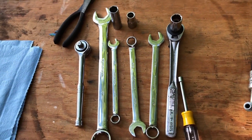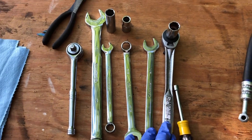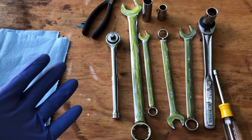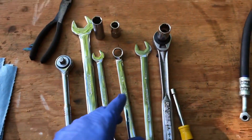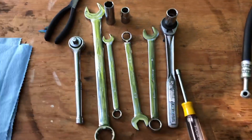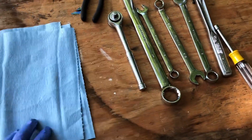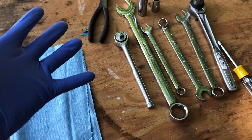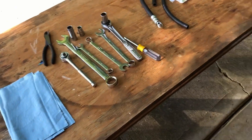In terms of tools, I'm not using any power tools today. An impact wrench would be handy when it comes to removing the pulley, but you can also use a socket. I'm also going to use a breaker bar. Everything is standard except for a 17mm socket — everything else is just standard sizes. You'll need a lot of towels, and you'll also need some type of bin to catch the power steering fluid because it's going to be a mess. And that's it — let's get started.